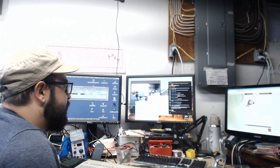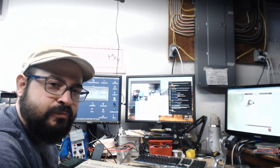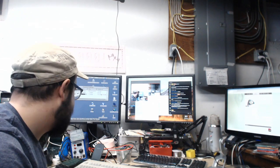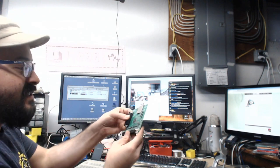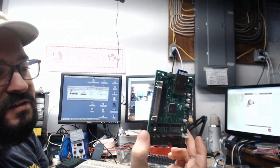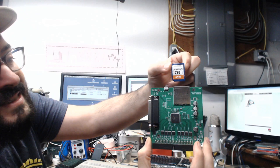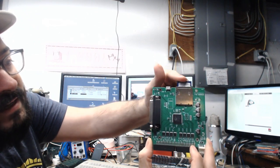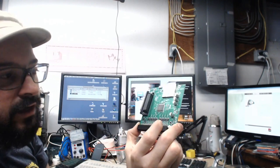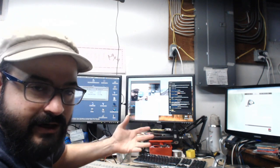Yeah, so the best way to make a bootable disk for another old Mac is to have another old Mac. That's honestly the easiest way. You could get an adapter, like one of these SCSI 2SD adapters. They run about $50, $60, $70. And it takes an SD card that you could write on a semi-modern Mac. And then you could boot from that. It acts as a hard drive. That is one way. Or you can get some CDs if you have an external CD drive. You could burn a CD.